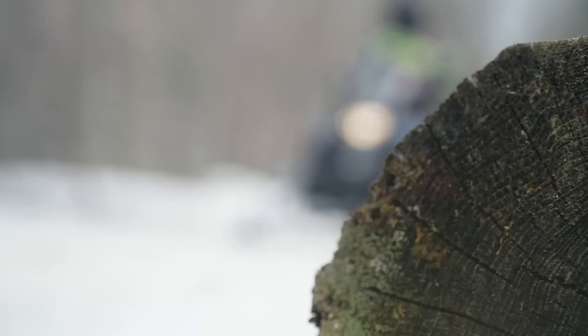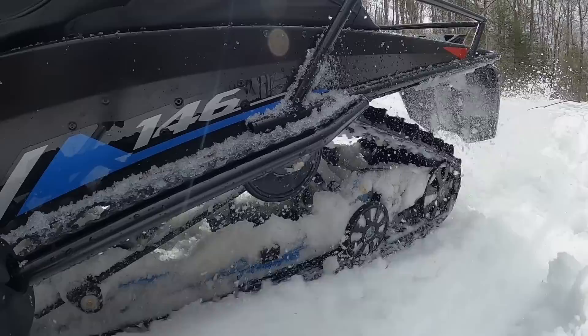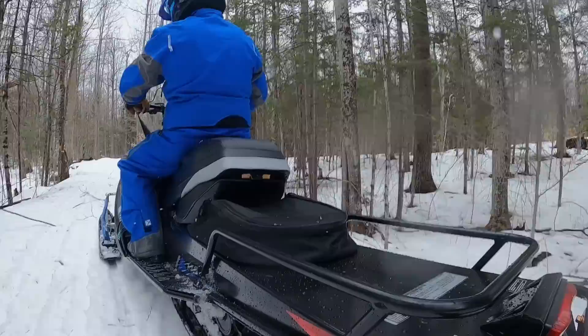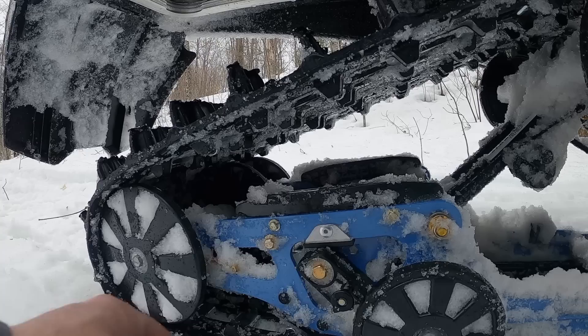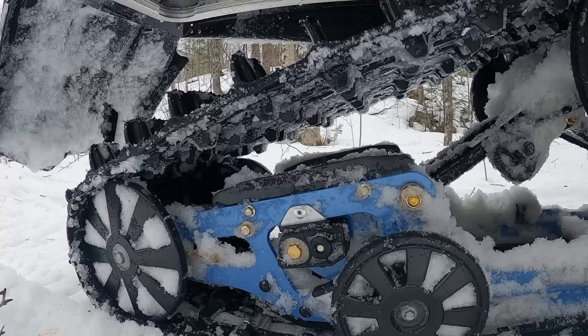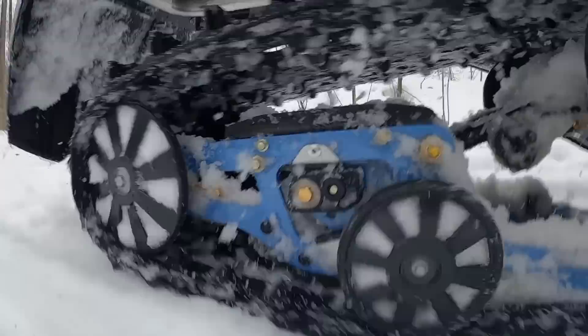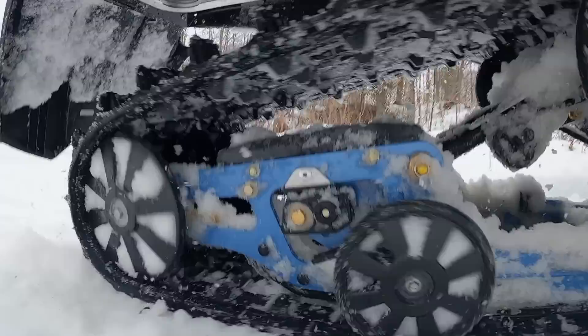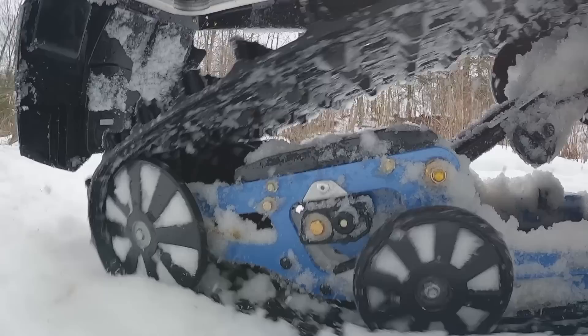In the Yamaha Transporter Light series there are two sleds. One is geared more towards work, the other more towards family fun — the Yamaha Transporter Light two-up. The first Transporter Light has a stretched-out chassis allowing for a 146-inch Cobra track to hook up the 400cc engine to the snow. It's a traditional two-rail suspension with 1.6-inch lugs equipped with one very high-end feature: the flip-up rear. This articulated portion allows the track to do a better job at staying on top of the snow when reversing or backing up over small obstacles. This flip-up system also makes the sled feel a little shorter, acting a little bit more like a short track, but it's also able to lock solid for when you need maximum flotation and grip.